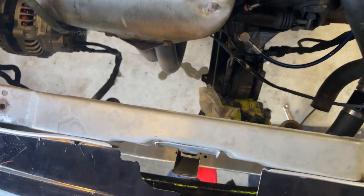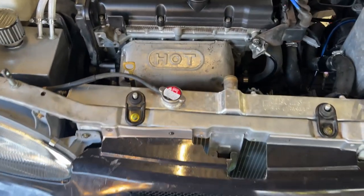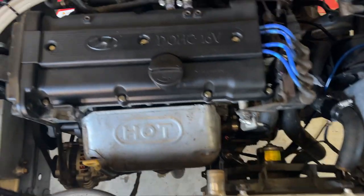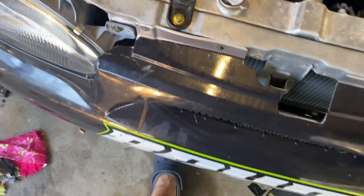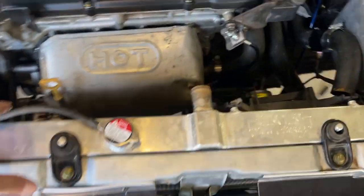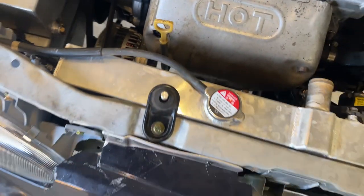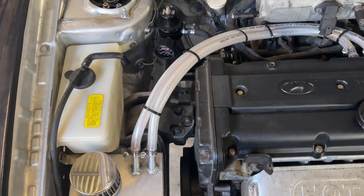Radiator is back in and doesn't look too bad - slightly skewiff but heaps of room. It does have a small kink to it but like I keep saying, it holds fluid and looking good. Now it's just connecting up the hoses, and then we can begin to get this thing back together - put the rear toe bolts in, put more clutch fluid in, and bleed the clutch.